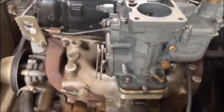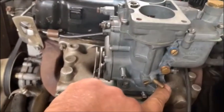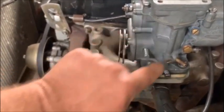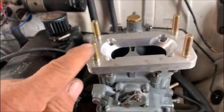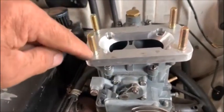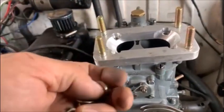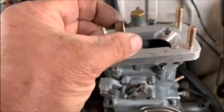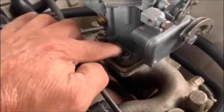This is where a lot of guys go wrong. Guys want to put bolts or Allen cap screws in there — please don't do that. Put normal studs in there. These are made from a bolt that was too long that I cut shorter, but go to your local nut and bolt supplier and buy 40mm studs. Put your 40mm studs in and you can lock them at the bottom with thread lock. You can also use these bolts with a washer and locking device, or normal M8 bolts. Tighten all four — you don't have to over-tighten them, this is only soft pewter.